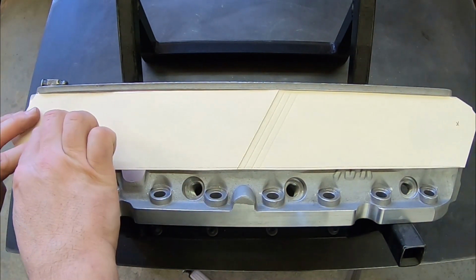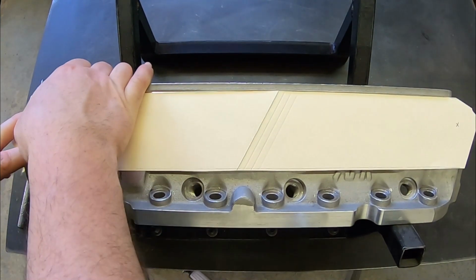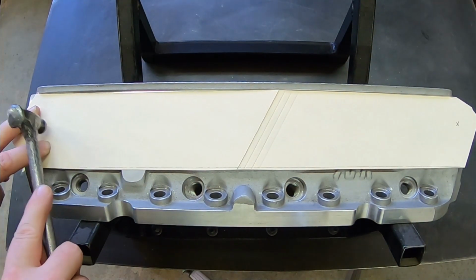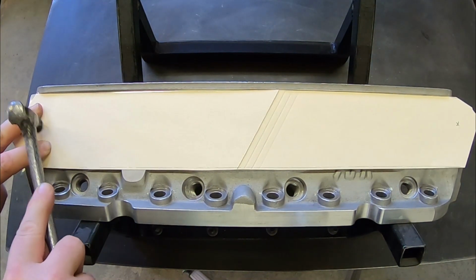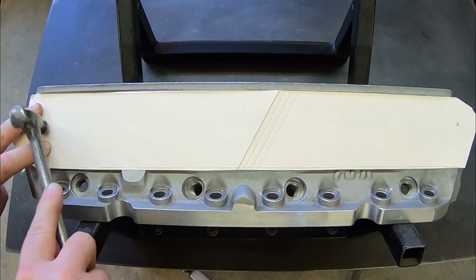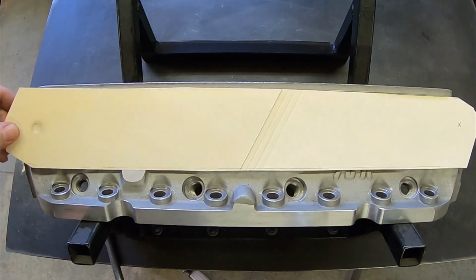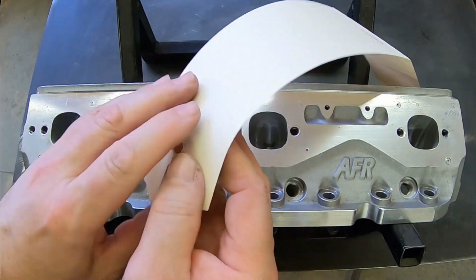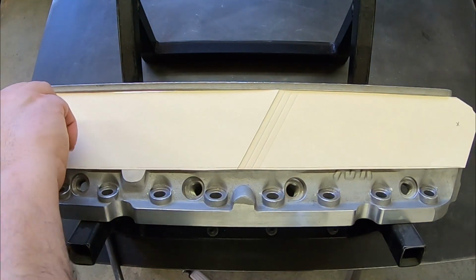Press down in one area of one of the outer bolt holes and rub it with your finger or your thumb until it makes an impression. Hold the folder tight and then just tap it gently with the ball peen hammer, and that will start an impression of the bolt hole. As you keep tapping, it will actually perforate the folder, and if the hole doesn't fall out, you can easily pop it right out. Put a header bolt in there to hold it.